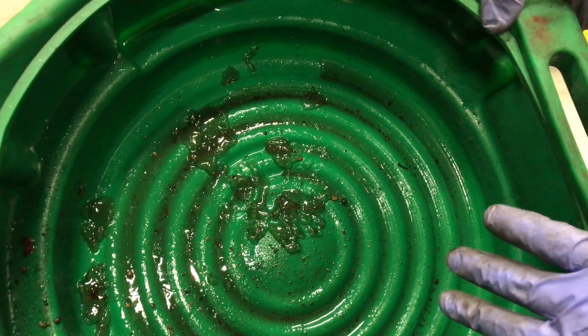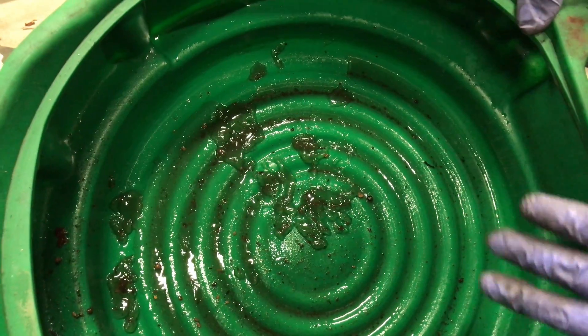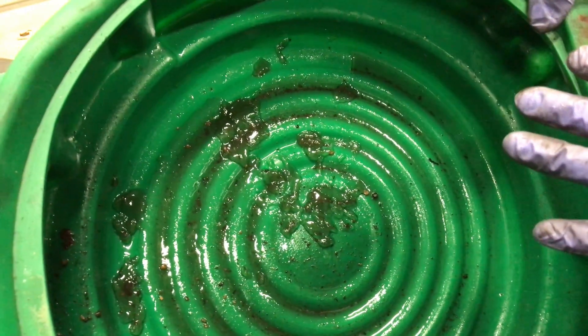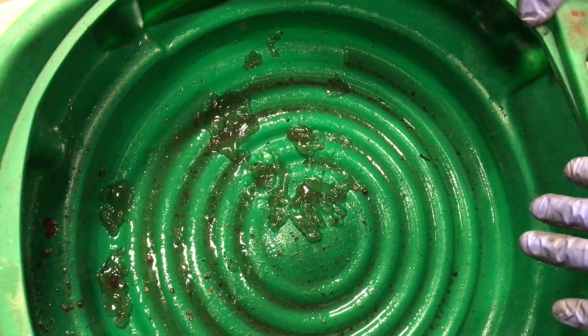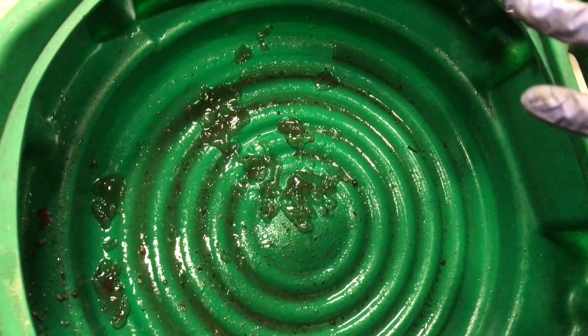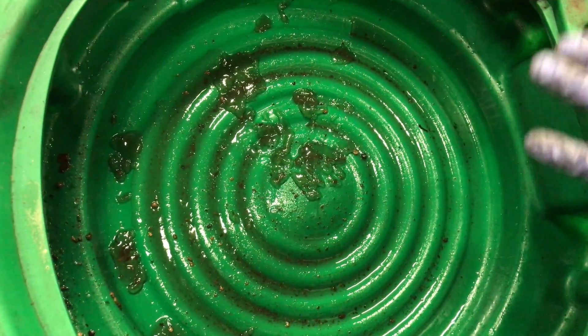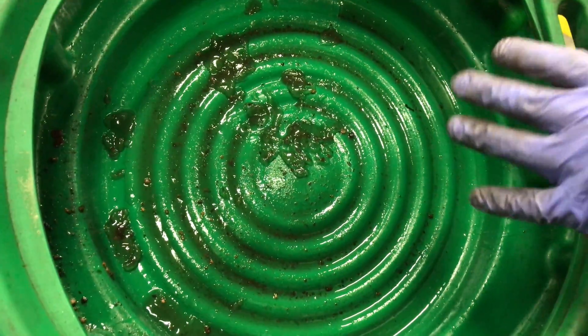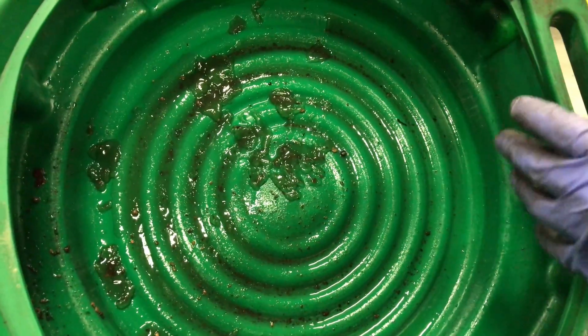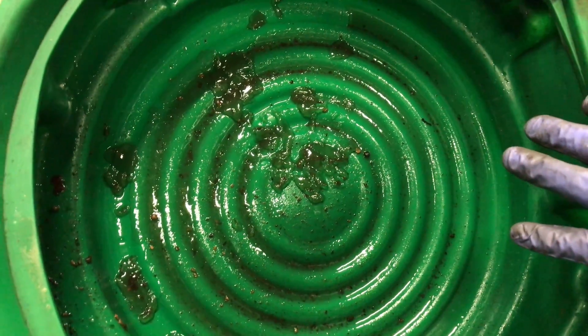If you need to top it up, you can put a little bit of water in, especially in the summer months, and then have the leak fixed — which usually involves draining the cooling system anyway. We'll measure how much pink antifreeze and how much water is in there, and adjust the ratio accordingly so it's back to its proper level of about 50-50 — you want 50% coolant and about 50% distilled water.